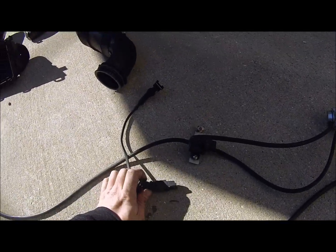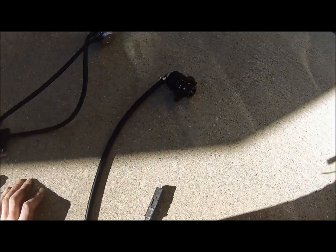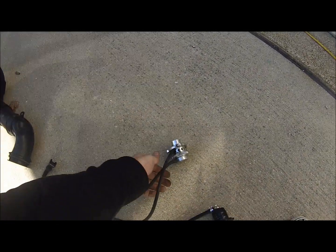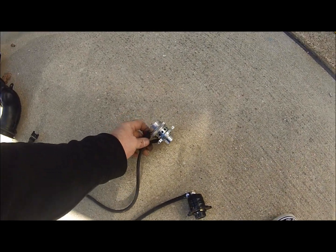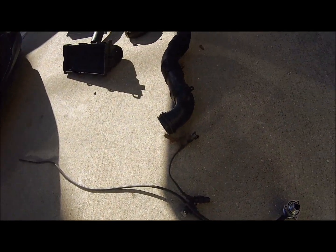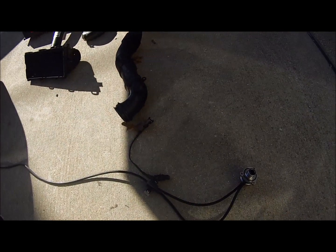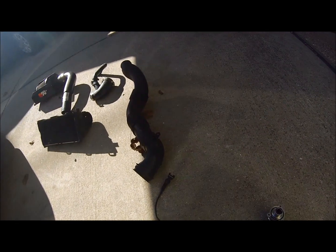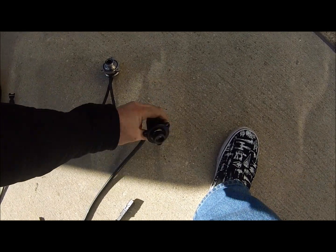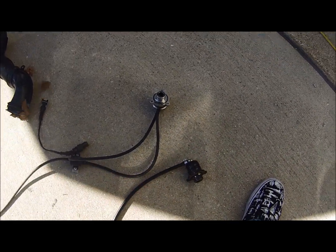I don't understand why Forge had to complicate everything by adding this solenoid. I mean, granted, it doesn't have a check engine light — I don't know if this one will yet, because it's used to the computer controlling everything. I'm not trying to knock Forge — it's a quality product, it really is. It's just annoying. Every time you let off the throttle, even if you're not even in boost — I've had negative 10 vacuum and it's still going off. It gets old. So that's why I chose the dual port, hoping to eliminate that issue and give it more of a sporty sound. Go ahead and install this, get some drive video, and let you know what I think.